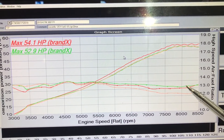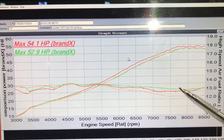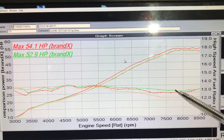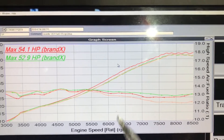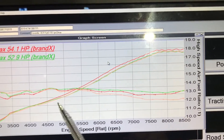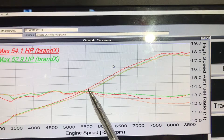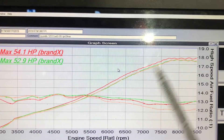The air-fuel ratio is quite lean — at about 13 to 1 near peak horsepower, which is too lean in my opinion. So the first change I made was to keep that medium comp head on it but change the fuel maps and the ignition maps. The end result was to get this red line here, which has more power right through.